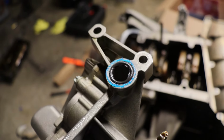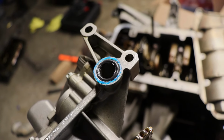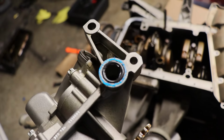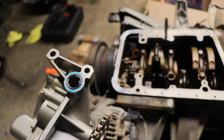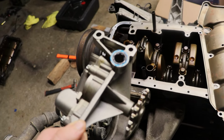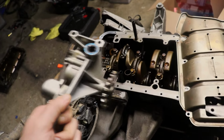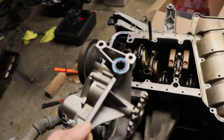All right guys, new O-ring is in. Little dielectric grease on the O-ring itself just to keep it in place while I flip it upside down, and then a thin line of the blue Hylomar around the edge, just for good measure. Why not clean up both surfaces beforehand? So let's take two, and I'm gonna be extra cautious throwing this on, eyeball aligned horizontally with where this is gonna seat, because yeah, we're not doing that again.